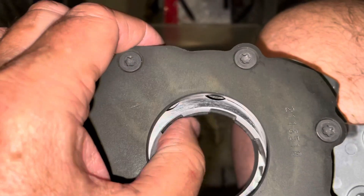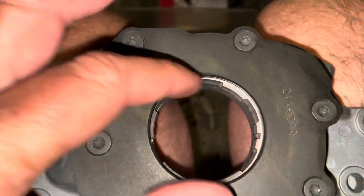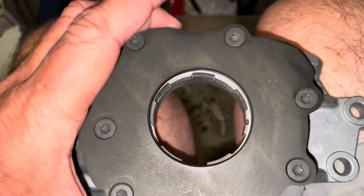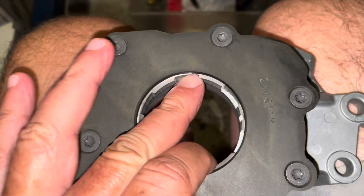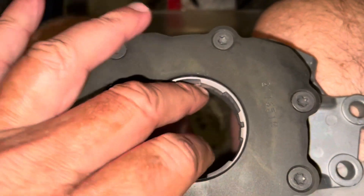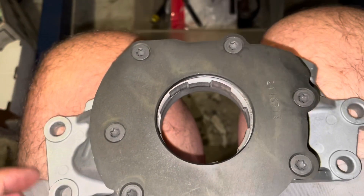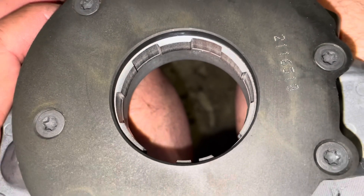This is the internal gear — you can kind of see the way it's cut out, there's a gap there and a gap right there, and those gaps mesh with another gear in here. The bigger internal gear rotates inside a machined cavity in this oil pump. This inner gear rides inside that gear wherever it wants to, because the dynamic forces and pressures of the oil will make this inner gear ride inside the other gear wherever the forces push it as it's rotating. When you put it on the engine, this gear is going to go to wherever it needs to.